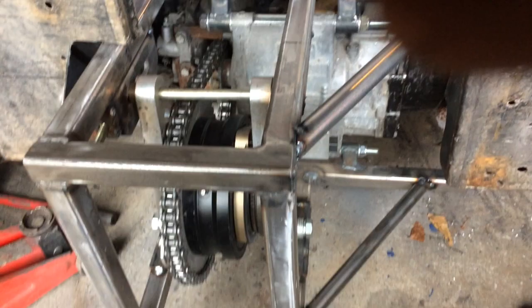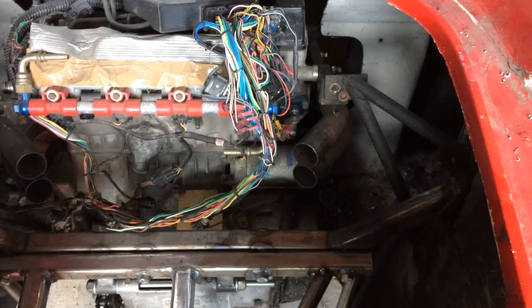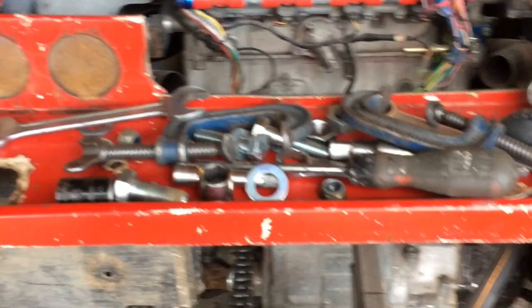There was nowhere to mount the differential, so we made up this subframe and mounting cradle that mounts to the back end of the Hayabusa engine and then bolts into the rollover structure and braces to the top mounts in the engine. There's a totally detachable rear subframe so you can take the whole assembly out to give you access to pull the engine back out if required.